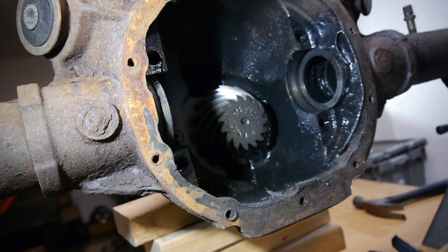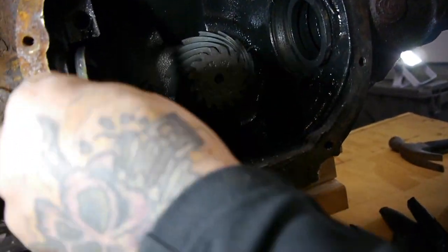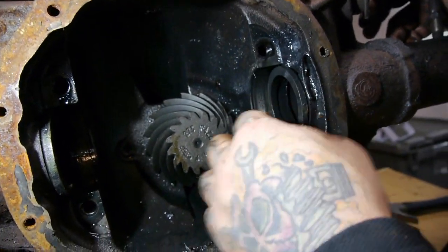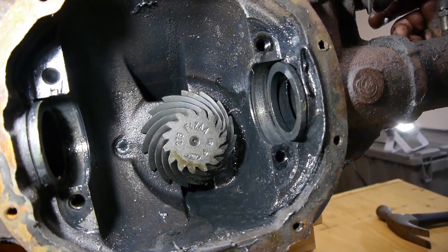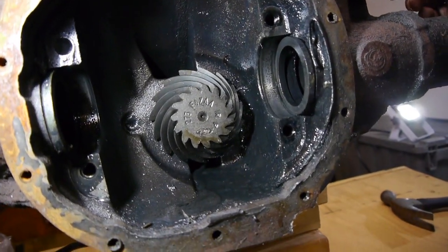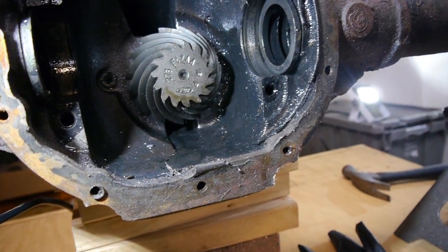Loads. Washers. Back here we're left with our spacer here. That's your side bearing. And our pinion. We'll be back to remove him in a little bit. Right now we're going to remove this brake caliper bracket. We're going this far already - going into powder coating. We already pulled out the carrier. We're going to go into bigger gear, bigger pinion, and all that good stuff. New bearings and everything.